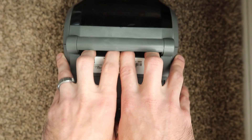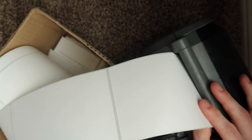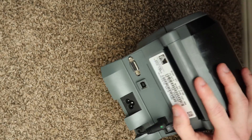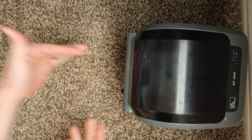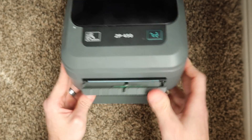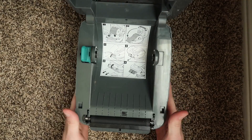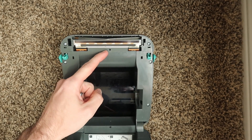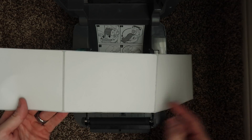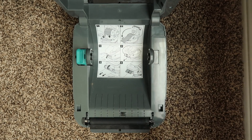Right here in the back we have a slit. This slit allows you to feed labels through the back in a fashion where the labels themselves don't fit inside the printer. So you could use the giant rolls you can get from UPS or FedEx, or you can buy the cheaper fan fold labels, put them behind the printer, and feed them through the back. On the inside we have our platen roller. We have a couple of sensor thingies — I think they're IR infrared sensors — which sense gaps between the labels in order to calibrate the printer and recognize where a label starts and where it ends.